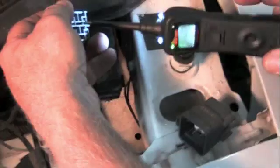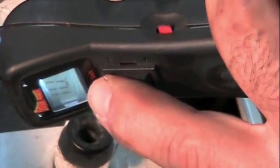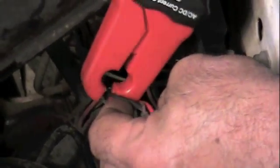I can reset my circuit breaker. Give it power again and watch the breaker. We powered the cooling fan, the cooling fan ran, but the breaker tripped on my power probe. That tells me right away I'm pulling too many amps. But let's use the lab scope and actually look at that signal. I'm going to put my relay back together, take my low amp current probe, switch it to 20 amps so it should show up to 20 amps, and zero it. Now I'm going to go to the relay, to the black wire which is the ground side of that circuit, and put my amp probe around it.